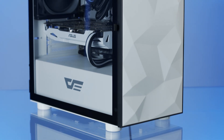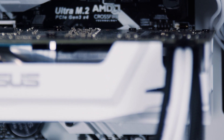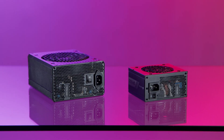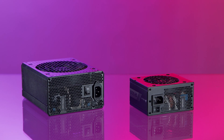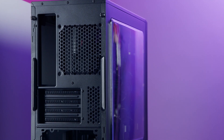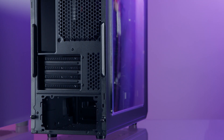You're not going to be doing Crossfire or SLI with a Micro ATX case as a general rule, but with the size, efficiency, and speed of the graphics cards on the market today, you can get most average-sized cards in these cases without harming performance. You may need to pick smaller components to fit a standard ATX PSU in the case, and some cases won't fit one at all. But smaller form factor PSUs have come a long way in the last five years, now supplying massive power, excellent stability, and at a similar price to what you're used to.